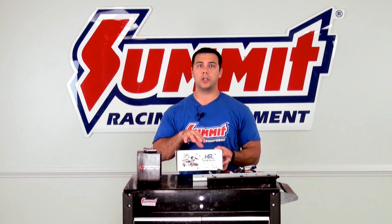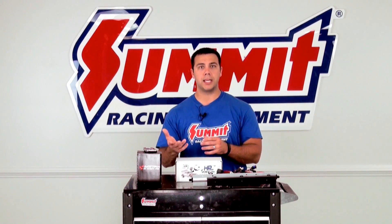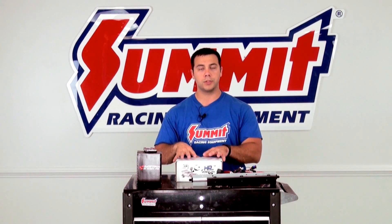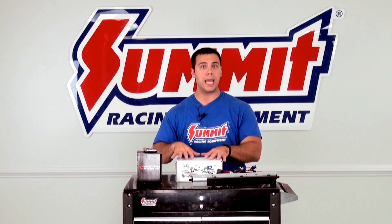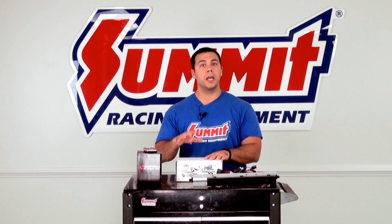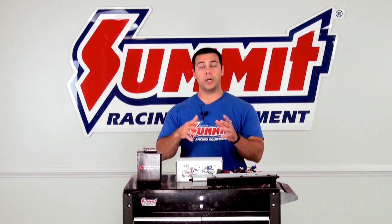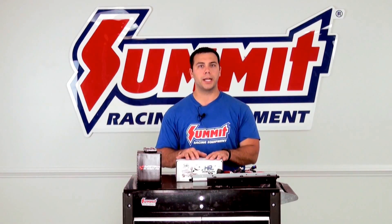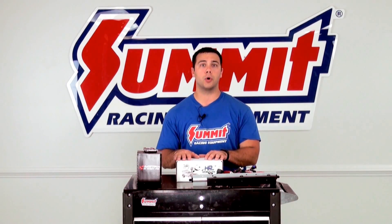There's also a lot of damage that you can do with this type of kit. Some of it includes leaning out your engine and running into detonation, throwing off the timing, and things like that — so I do urge a lot of caution when you step up to a kit like this. If you need a custom tune but don't want to damage your engine, what I recommend is finding a custom tuner at a dyno shop local to you, talking to them, and then when your engine and project are together, taking it over to them to run it on the dyno and figure out that custom tune that's going to fit your vehicle perfectly, achieving the goals that you're looking for.